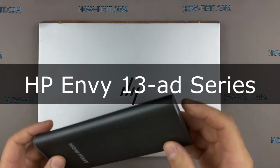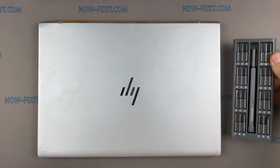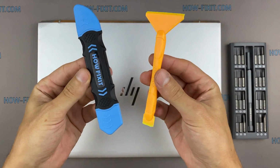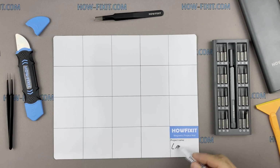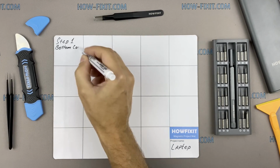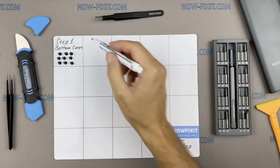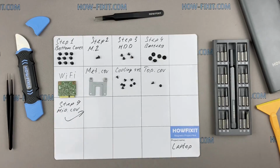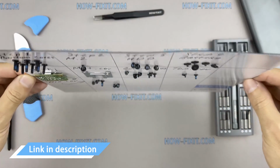In this video I'm gonna show you how to replace the fan in a laptop. To disassemble you will need the following tools: Phillips 1 screwdriver, Torx T5 screwdriver, plastic tool and tweezers. Also I recommend using a magnetic mat in the repair process and laying out each screw step by step during disassembly, which is especially useful in the case of this laptop, and it is very important not to confuse them during assembly. In the description I'll add a link where to buy all necessary tools.